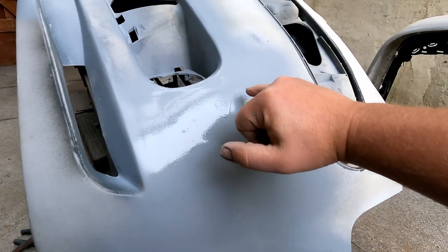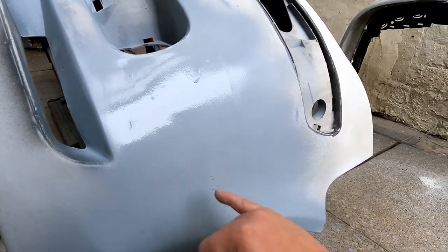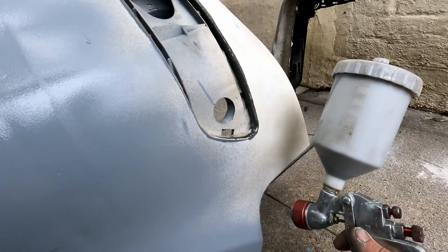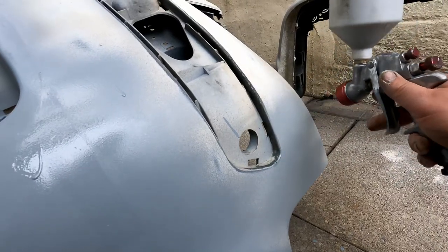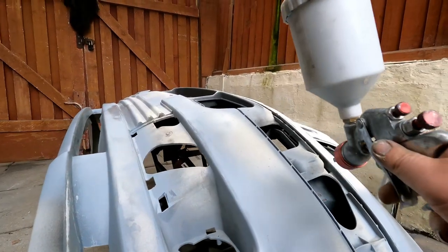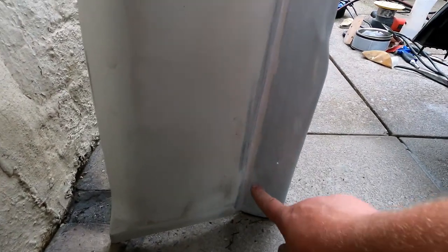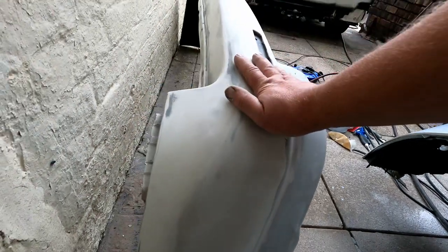You can see particularly there it's just a little bit pitted, so I've built it up a little bit trying to fill it — we'll leave that to dry. We might as well cover the whole way. On this back bumper I've done the same sort of thing — there's a little bit of filler in there that's all dry. I'm also going to build that up as well and then paint the whole back bumper.